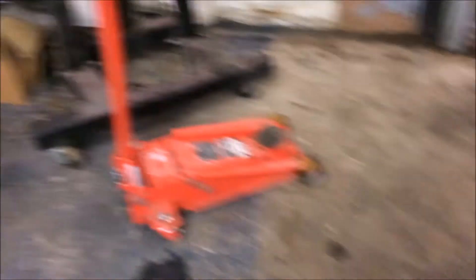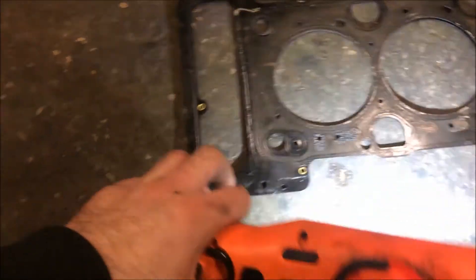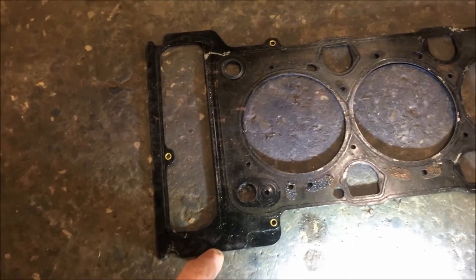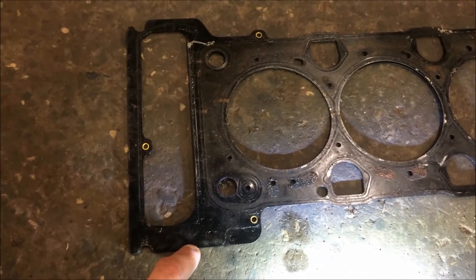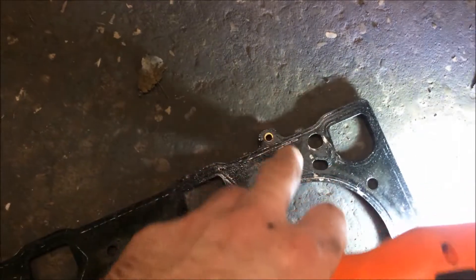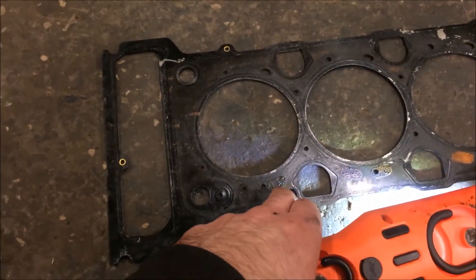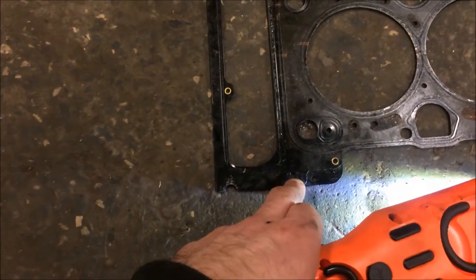And I'm fairly sure where that bubble is — it's from this bloody thing here. This is the old head gasket there. Fairly sure we're leaking — well actually we're leaking there, where we're bubbling from. On the new gasket, the hole was like oval — you couldn't even fit the dowel on the back, you can only fit the dowel at the front. So I made sure that fitted the gasket before I even lifted the cylinder head up. I emery clothed the dowel, made sure it fitted nice over the gasket. But we're bubbling from there, so we must be seeping from there.